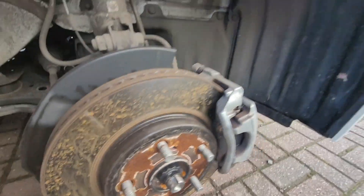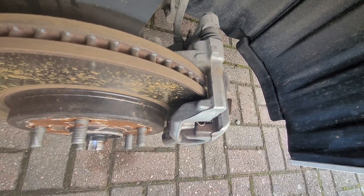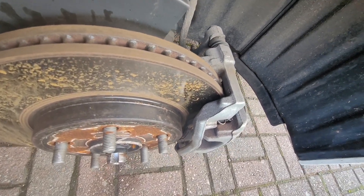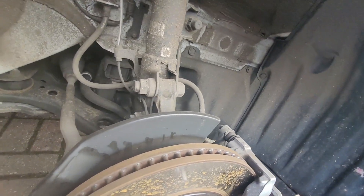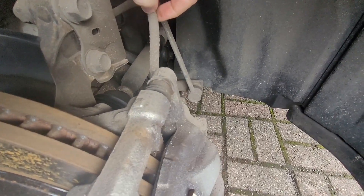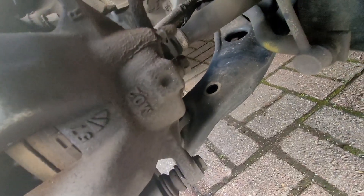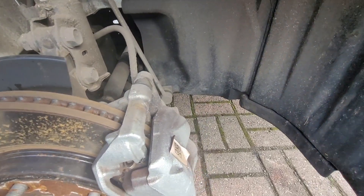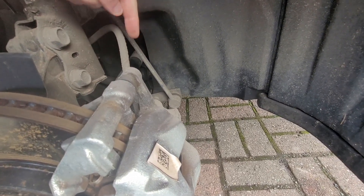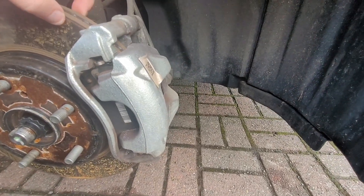That friction creates heat, and that heat then gets lost to the atmosphere. The brake disc gets hot, which is why it's got these sort of corrugations in there as well — the larger surface area is going to let the heat dissipate a little bit more. Now you can see there are a few hoses and cables amongst here. This flexible tubing there is a brake hose or a brake line, and that connects into the brake caliper. So when you put your foot on the brake, essentially you're pushing brake fluid — hydraulic brake fluid — down the brake hose or brake line, which then squeezes the calipers, which squeezes the pads onto the brake disc.